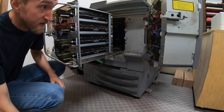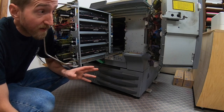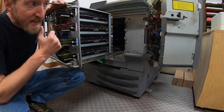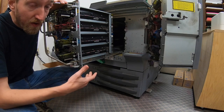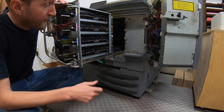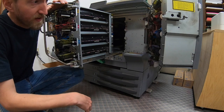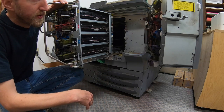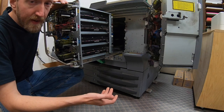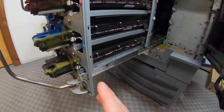This machine is obsolete and there are a handful of parts you cannot get for it, but they are workhorses. I think this machine is nearing about eight million clicks and still going strong. The parts that need to be replaced — developer, drum, corona, transfer belt, fuser, some gears — are all still made. So as long as you don't have a catastrophic board failure, you're good to go. These things are rock-solid.